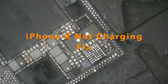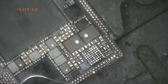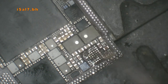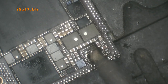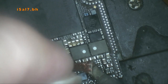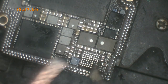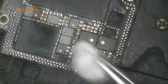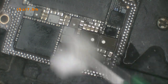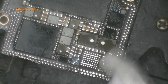Today we're going to talk about iPhone 10 not charging fix. Usually iPhone 10 has a problem with Tigris — that's where the fault most of the time is on this iPhone. I've removed the Tigris 2 IC, but during the removal I checked the coil. The charging coils, those two big coils on the side of Tigris 2, sometimes get loose, disconnected from the pad, and they lose continuity.